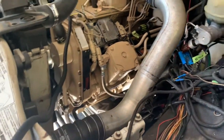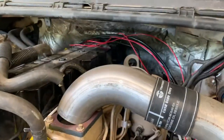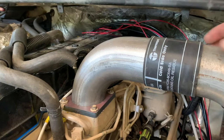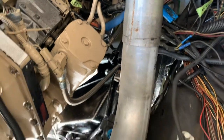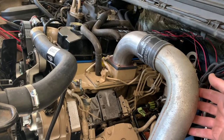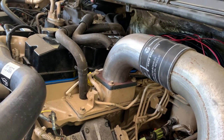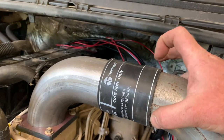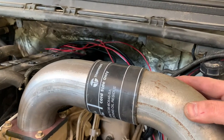Here we've got our charge air pipework mocked up. We've got our DIY high-flow flange kit, and the plan is to tack that in place and then tack our slip joint right there to make this whole intercooler pipe come together. We're going to index that 90 off of our flange and get that tacked into place so we can have everything stable, then make sure we have the right amount of space between the end of this pipe and the end of this pipe for our joint. Then we'll work our way down.